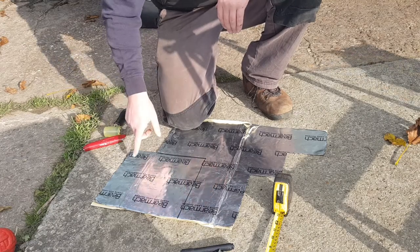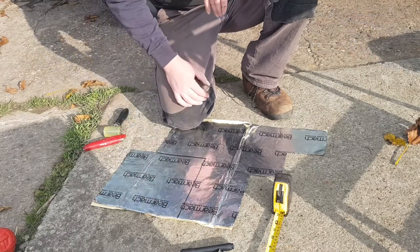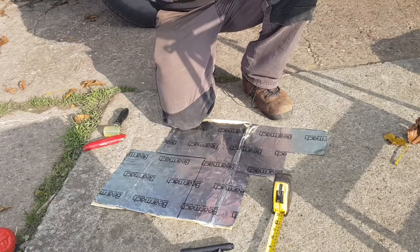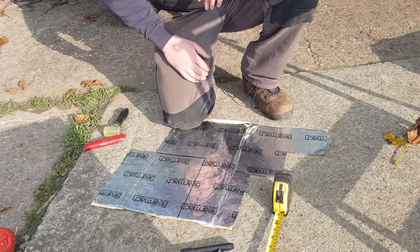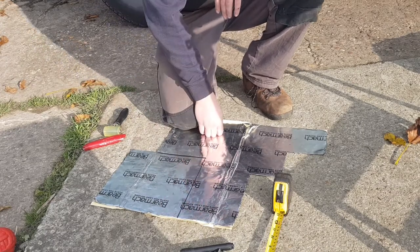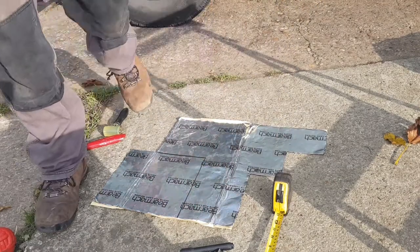So I've just measured out the bulkhead now. So it's 10 inch by 10 and a half inch. Get that cut out, offer it up and see where you need to trim it. That's how I find the easiest way of doing it. So just mark it out now and we'll get that fitted in. We've got all the bulkhead and the footwells to do before we fit the interior loom back in.